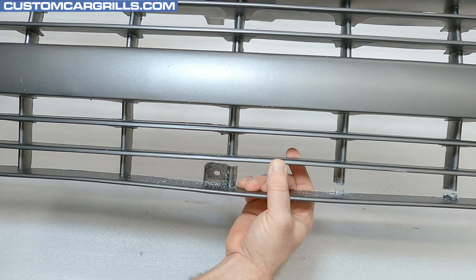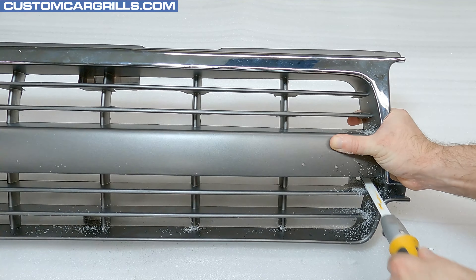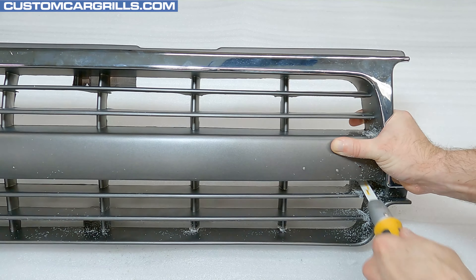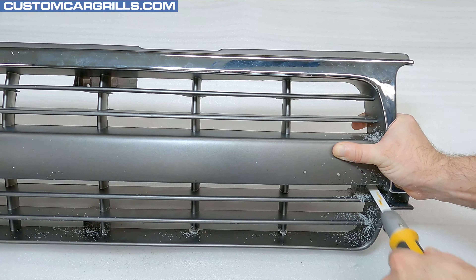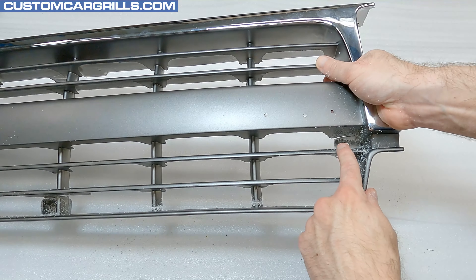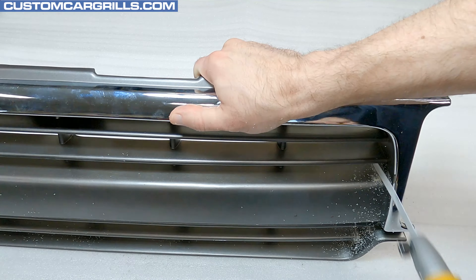In that area, I'll cut around a little higher than needed and come back to trim it down later. Here's a closer look at how my cut looks on that lower edge. Similarly, on the side mounting tabs, I want to keep a lot of the surrounding material so that there's some strength to it when we're done. I'm cutting at a slight tilt so that I'm cutting into more of the thick bar than the tab itself. This will be a little different for late model owners since they don't have the big bar here, but it's a similar principle that follows nonetheless.